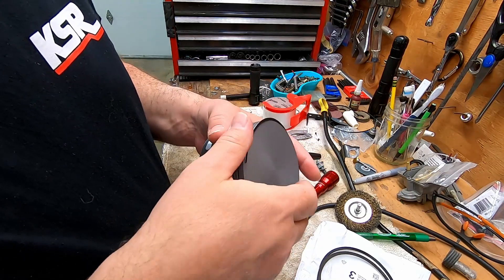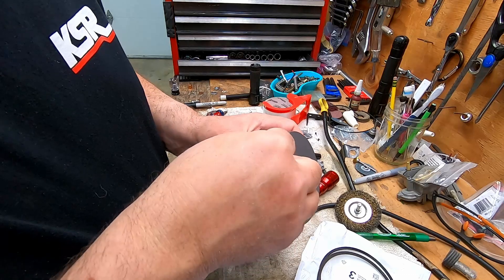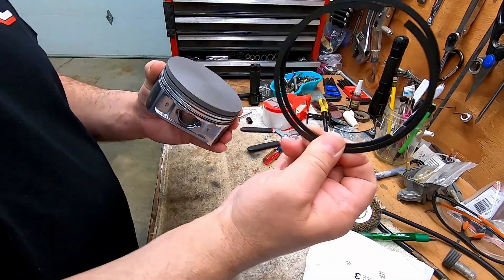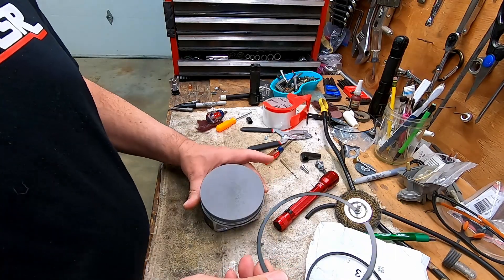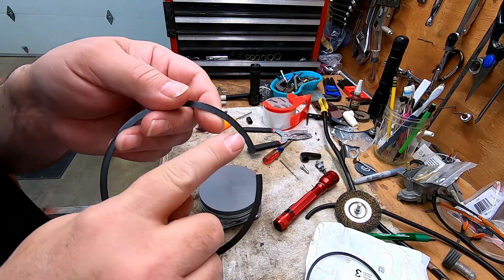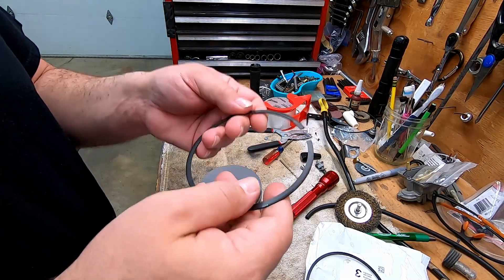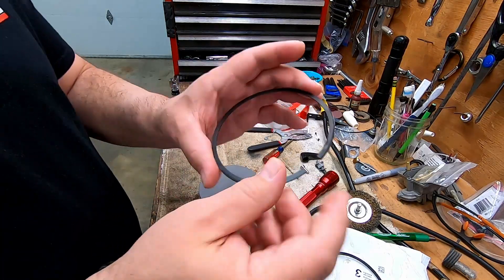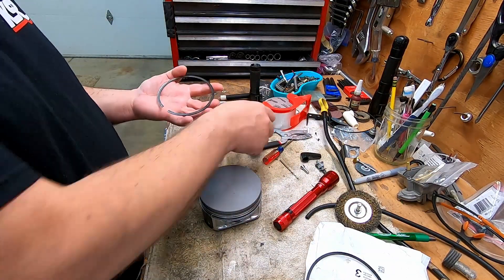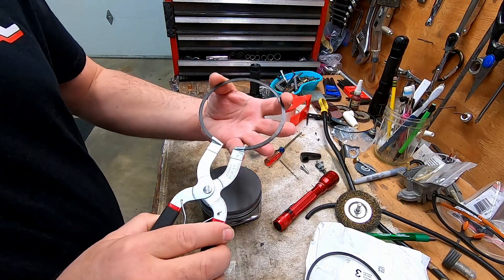It's okay to spiral the oil rings on because they're really flimsy. The instructions for the pistons clearly state, however, do not spiral the compression rings on — use a ring tool. So this is our second ring and it is etched with 'top.' There's no dots anywhere, it's just marked. That doesn't mean top ring groove, it means up — so this one I'm going to put at the top of the engine.